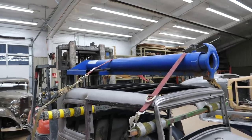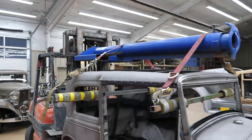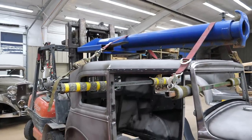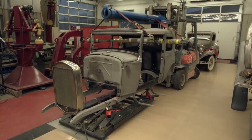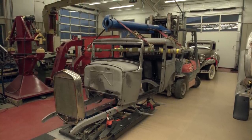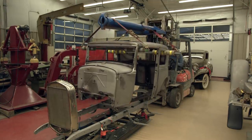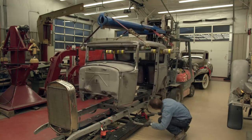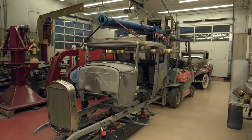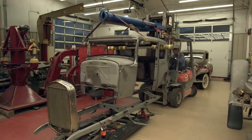It's a really big day and a call for celebration. I put the jib on the forklift and I've got it strapped up here with a couple axle straps to some spreader bars. Really pretty simple setup. The only real risk is the doggone thing can roll over sideways, so you got to make sure that that's okay. But it works really well and I usually end up doing all this stuff by myself. What I'm doing right now is I'm making sure that the rubber pads are not stuck to the body — I really want those to be left with the frame as I'll show you in a minute.